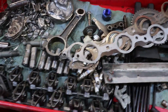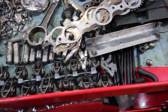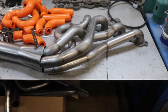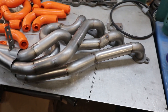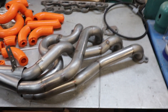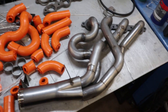Maybe the push rods and rockers could be reused. The lifters - they take oil, and there was a bunch of metal debris in there, so I probably would not reuse those. Maybe some of the hardware can be reused. So now we have a 6-liter instead of the 6.2-liter in there. And I was going to make a better set of headers for it - this is my first attempt at making headers, not something I've ever done before. I did a bunch of research and practiced cutting tubes and tack welding and that sort of stuff. In the car, I was able to mock up a long tube set of headers here.